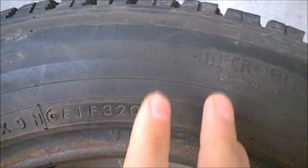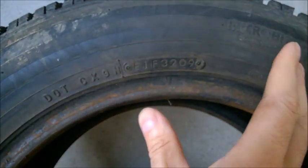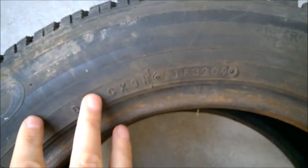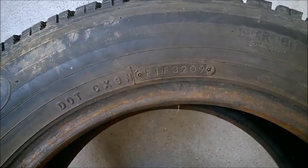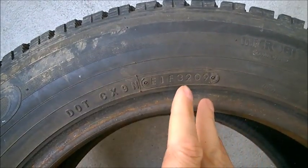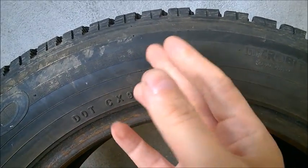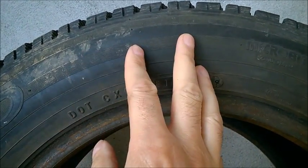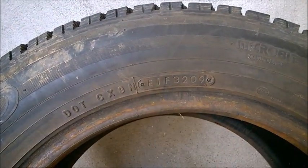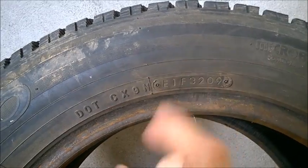So this tire was fabricated 10 years ago. Most tire makers say to replace older tires after six years, and some tire makers say they will last ten years. But there is a small detail to that — the lifespan really depends on whether the tire was kept outdoors in sunlight, since UV light deteriorates the rubber compound, or if the tire was stored somewhere in a garage or inside, covered up. In that case, the tire can still be good at ten years old.